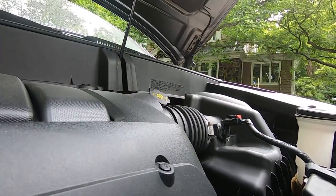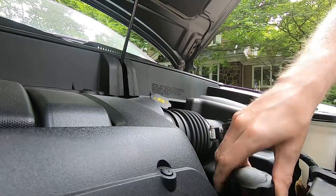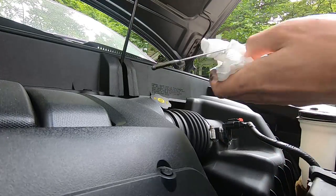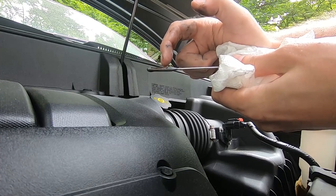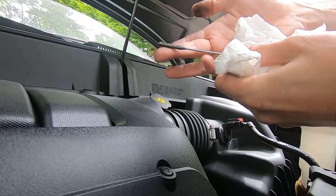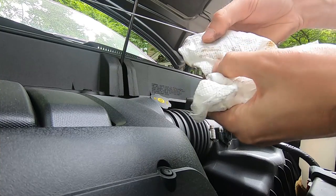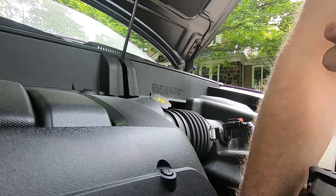We're gonna do the same thing — just dry this off, get the dipstick in, and get it out. And what do we see here? It's up to the hot sign here — it's a little bit more than we need, but it's still fine. The condition of the oil I don't like though — it's brownish. If I dry it off, it looks brownish. It should be red. So that should be changed.